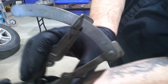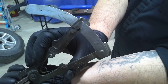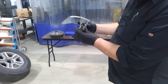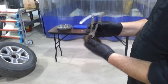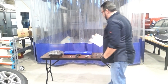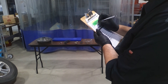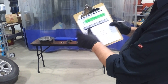That number is nine and a half on that — pretty tough to see. So we will round down to nine. We can double check it again on the other pad to make sure we have consistent numbers, and we do — that's like nine and three quarters on this side. So we would document that pad as nine thirty-seconds of an inch. Red nine on the gauge.